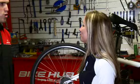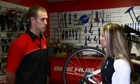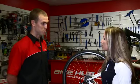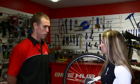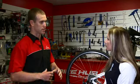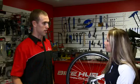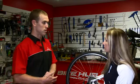Moving on to road bikes — there are a lot of different types of road bike tyre. It's a little bit simpler because we don't have to worry too much about treads. We bring in a new topic which is TPI, or threads per inch. You often hear a salesman or read about a bike tyre that has a TPI rating — the more TPI, the better. That's because they use a thinner thread in the construction of the tyre, which means they can use more of it, making the tyre more supple and with less rolling resistance, so it moves faster along the road.